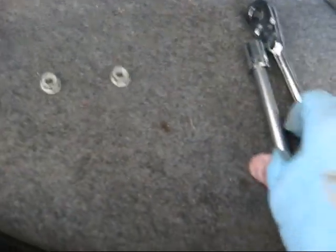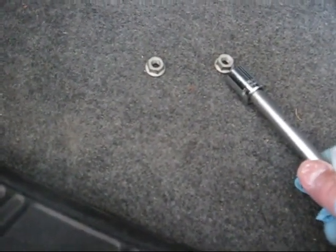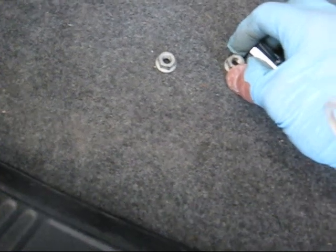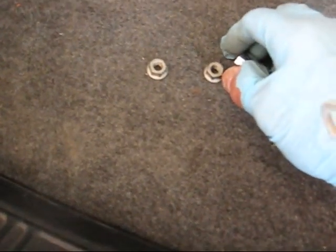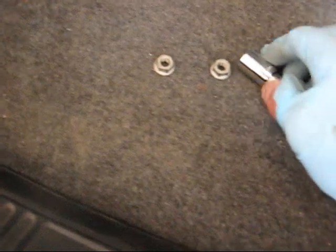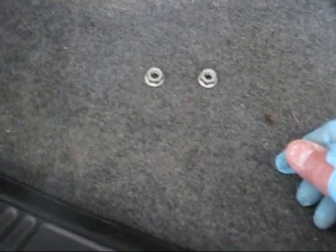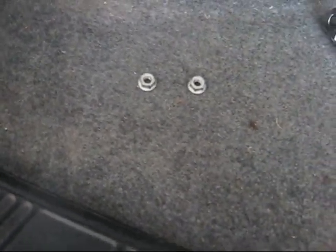You take these two nuts off — I think they're 13 millimeter. Yep, 13 millimeter. These nuts have a built-in washer; they're also what you call squash nuts — they're slightly distorted so they're self-locking. On the final few threads they lock onto the shaft of the shock absorber. Make sure you use the right kind of nuts, or put lock washers on there, or use removable Loctite.